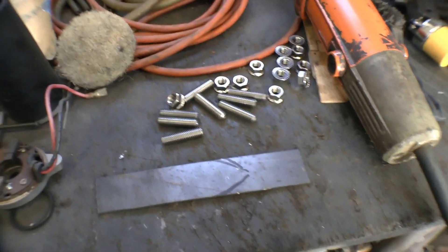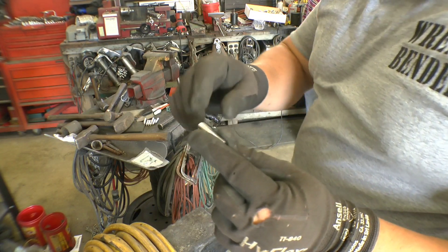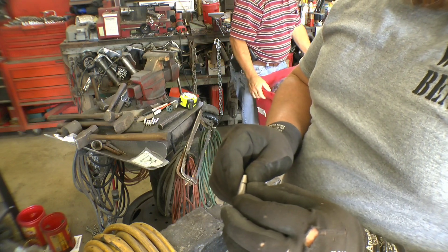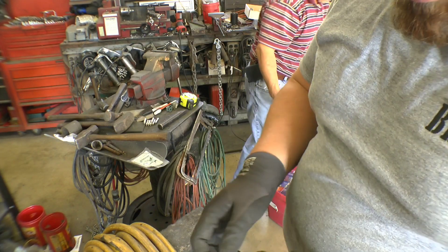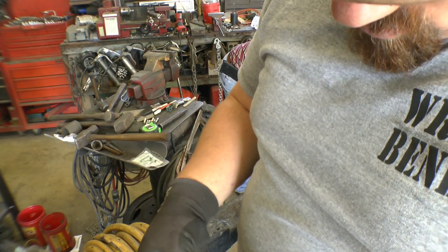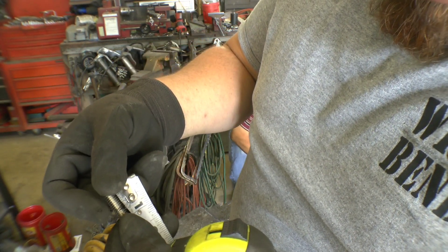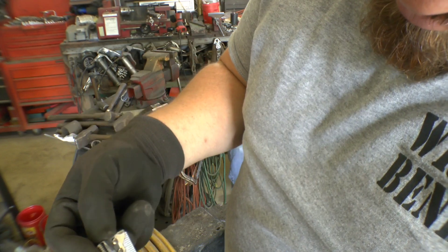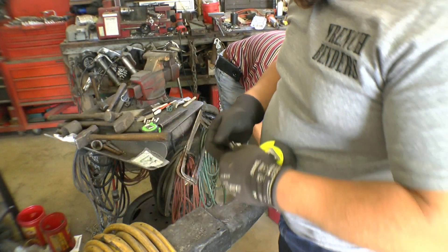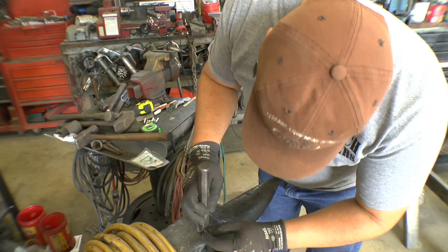I'm going to show you what I'm going to do to make sure those stay situated in the right place in the engine. These are threaded all the way, so you can thread them all the way in until they bottom out, but you don't know how much length you'll have sticking out when they bottom out. So I'm going to control that. I know I want to make a mark at about 5/8ths — that's where I want my mark. I've marked it right about 5/8ths from the end of the tape measure to that one thread right there. Now I'm going to take this chisel and put it right on my mark in between the threads.